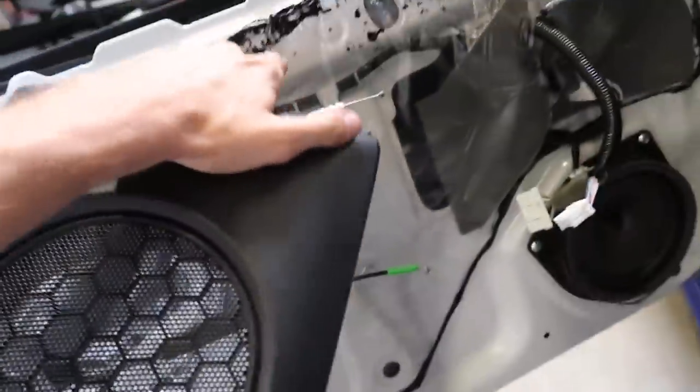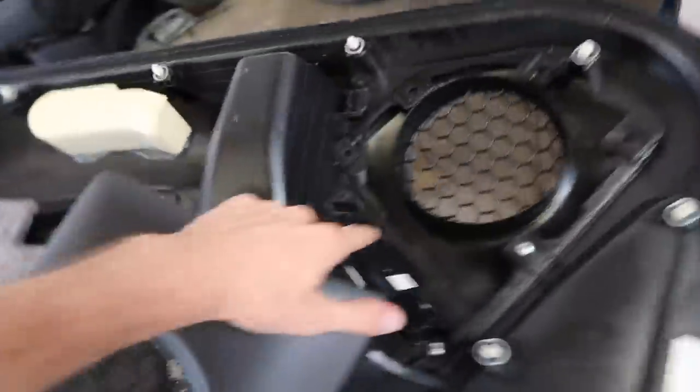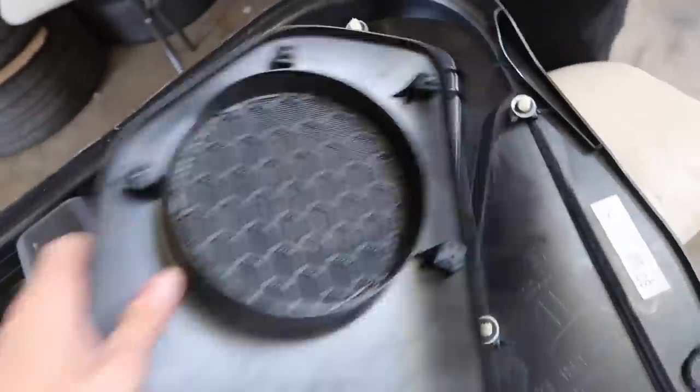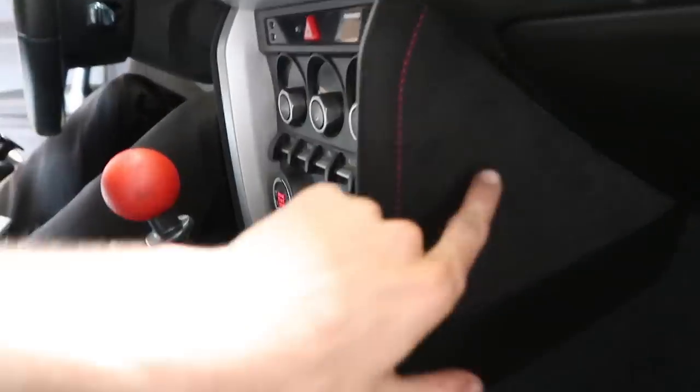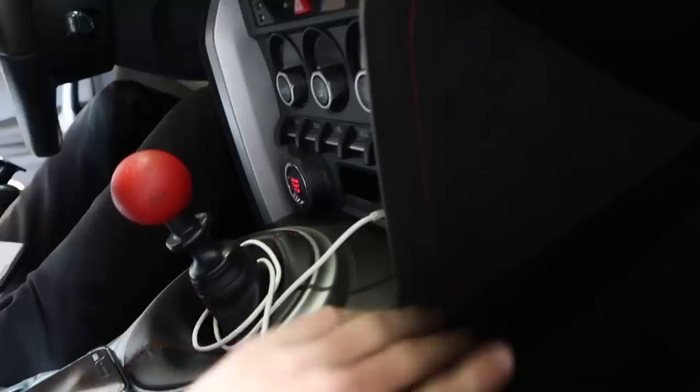For the speaker panel we're replacing, all you do is simply take off the door panel and turn it over — it's pretty much this right here. Take the screws out, put the new one underneath, screw it back in at all its screw points, put the panel back, and that's it. So you have the normal leather and right here you have the Alcantara suede that matches what the seat linings are. If you're an interior guy like me, you'll find the art in that. I like having a clean, updated-looking interior — especially for the BRZ, I try to put the nicest parts on it. I also added these padded knee pads from the same company almost a year ago.